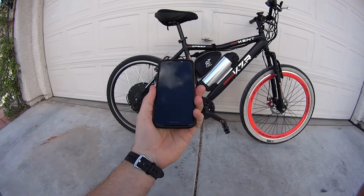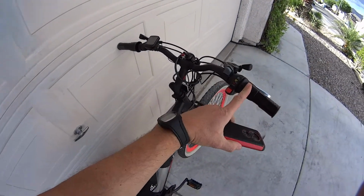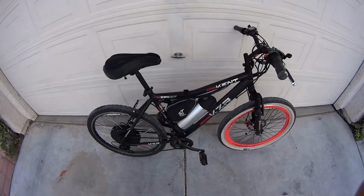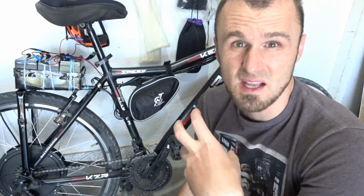Another conclusion that I could reach out of this video is that if you're trying to buy a Chinese lithium ion battery, don't. It seems that the Chinese have a different culture over there where lying on the battery pack is absolutely okay. If a battery drains to almost zero, or just resets itself off every time you try to use it, and when you charge it, it only takes about 150, 140, maybe sometimes 100 watts of power, that means you haven't used more than 100 watts of power out of it. So it's either a defective battery or something was wrong with it. Most likely there are cells missing, because to save costs and be competitive on eBay, they take cells out and sell it as a 10 amp 36 volt, but it's not.